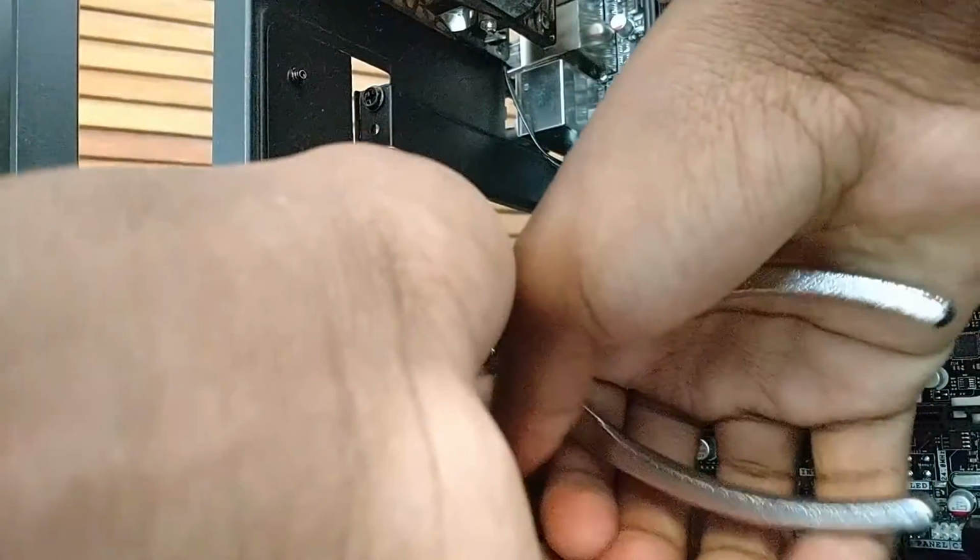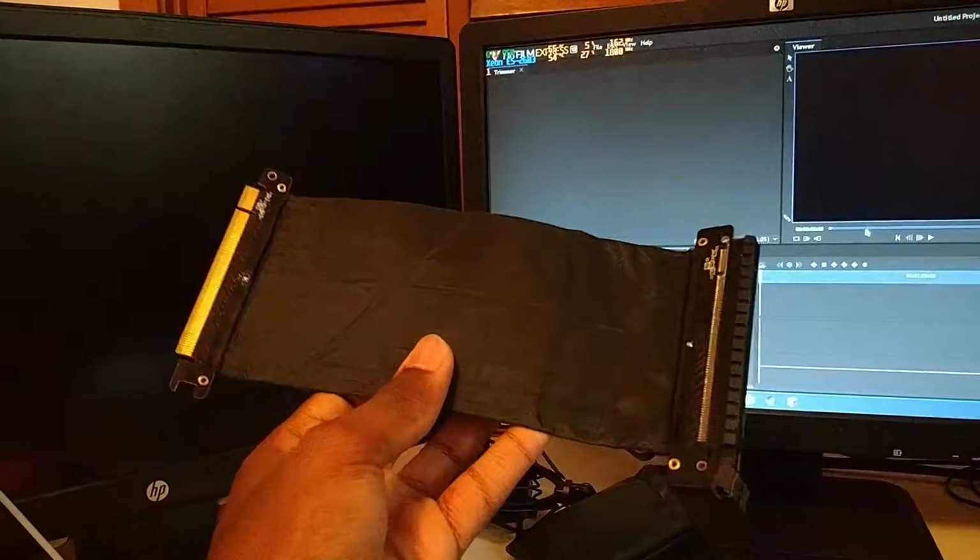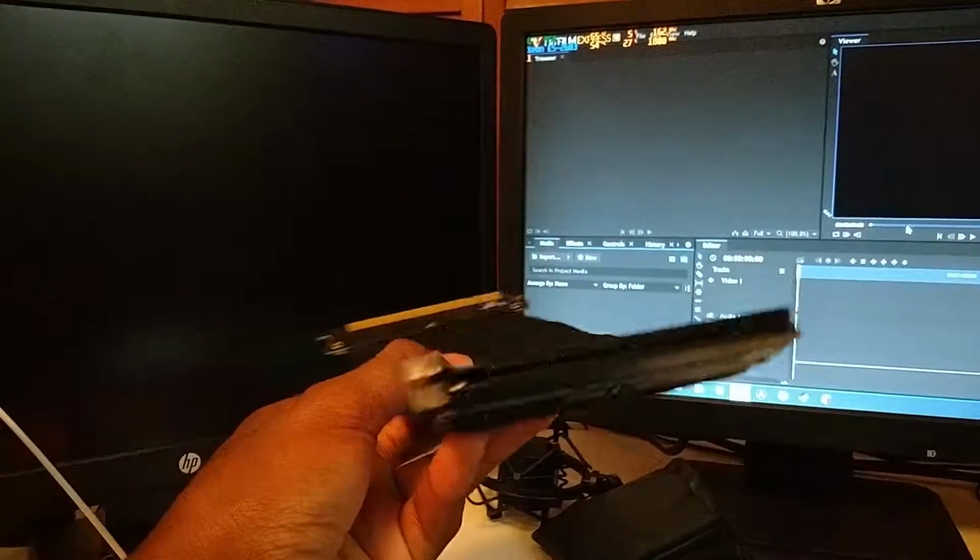After you remove the necessary expansion bars, the mount can be mounted to the case. If you don't have a 90-degree PCI Express extension cable, I'd highly recommend placing it as high as your case allows. Once that's figured out, all that's left to do is screw in the mount to the PCIe screw holes, and now the mount should be completed.